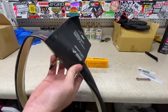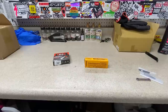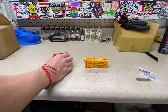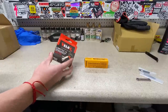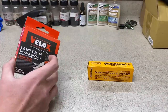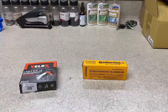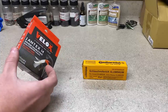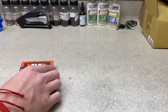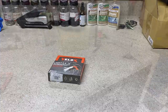I'm going to show you the whole process. We're going to install the tape on the rim and I'll go over everything. We've also got to install the stem extenders to fit these deep dish wheels. You guys will probably never have to do this yourself, and if you do struggle with it, bring it to your local bike shop — they can install it for you pretty quickly. One thing to know with tubular tires: after you set this platform with tape or glue, it's always best recommended to not ride on it for 24 hours. Let the adhesive cure for about 24 hours. So without further ado, let's get into the tire installation.